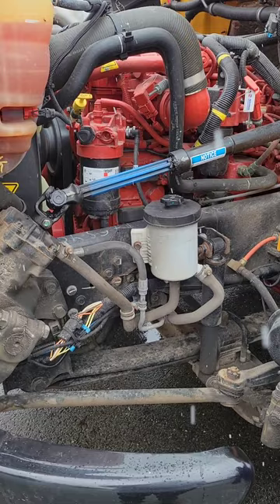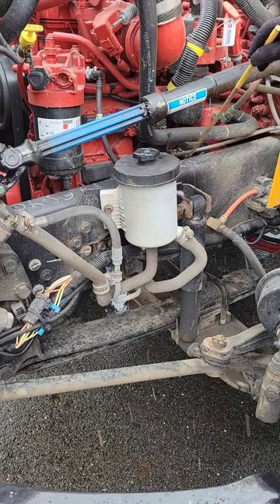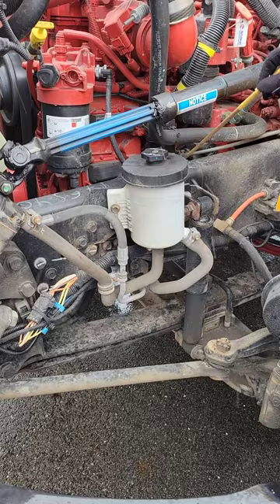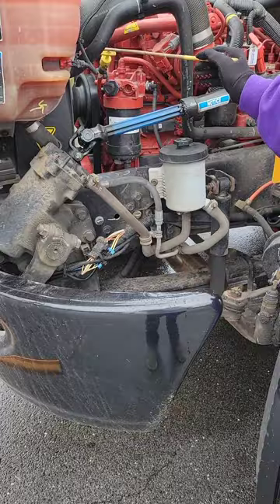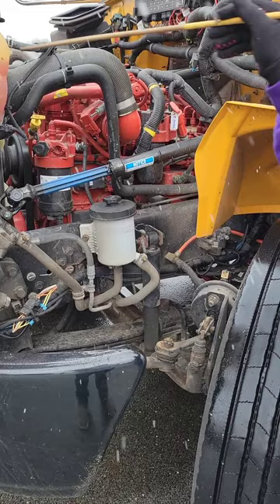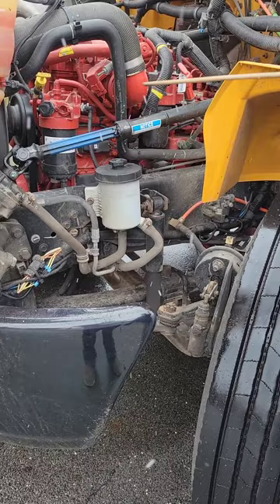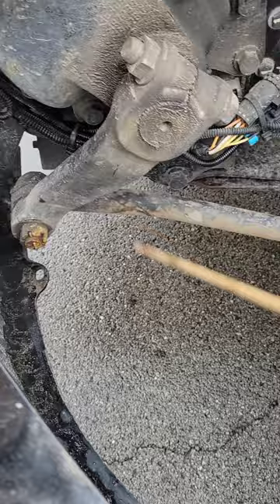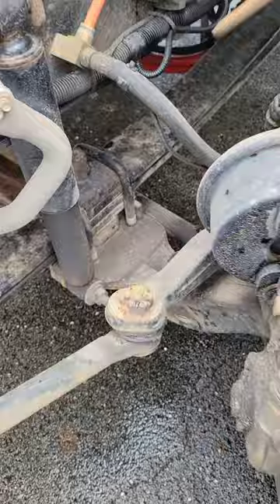I put the hood up. I see no moisture on top of the engine or fresh puddles of fuel, oil, or coolant underneath — any of those would indicate a leak. The wires are not bare, broken, or frayed. None of my hoses are bulging or leaking. I'm going to follow my air hoses down to my air compressor — it sits just inside the frame rail. The air compressor and power steering pump are gear driven and secured to the engine. The air compressor is not leaking air or oil, and the power steering pump is not leaking oil. My oil and transmission dipsticks should read between add and full — I would check oil daily on a cold engine, transmission fluid weekly on a warm engine. Coolant and power steering fluid are both between add and full, caps are tight, no leaks. My steering shaft has no more than two inch play, is not bent or twisted, the U-joint is tight, gear box is secure to the frame, not cracked or leaking. The pitman arm, drag link, upper and lower steering arms, and tie rod are none of those bent or twisted — all secure with castle nuts and cotter pins.